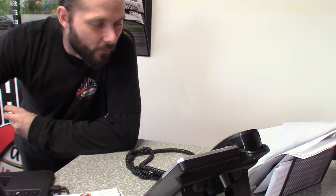Hey Paul, it's Jim from Highline. Hey, how are you? Good. So I got the Jetta in, got a look over it to see what's going on. I definitely heard the noise when you dropped it off. It's the front brakes. So I priced it up. It's funny, because I'm pulling it apart after inspecting it, and that left front is terrible. That's the side that's grinding on you. You look over on the other side and it's just normally worn out. So something failed on that left front. It's the caliper, it's locking up. That's what originally failed on you. It got hot, the pad kind of stuck in there, and then it just got worse from there.